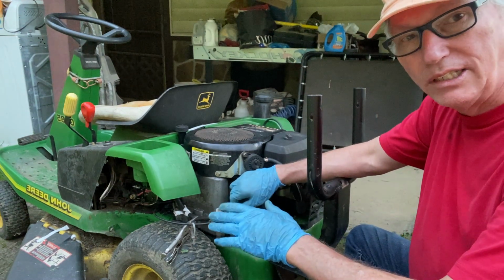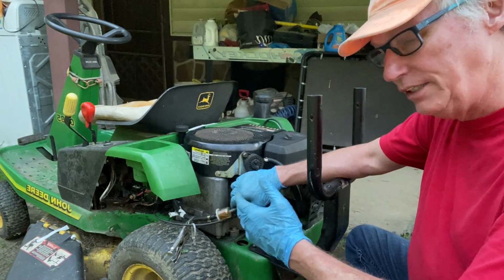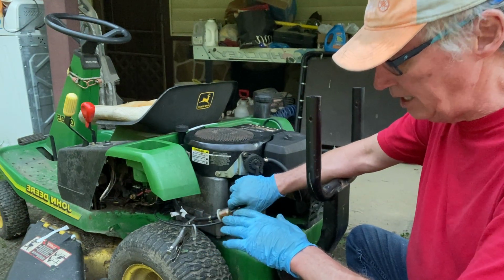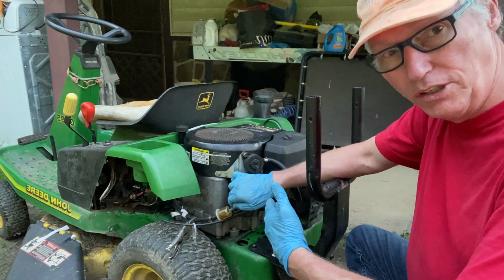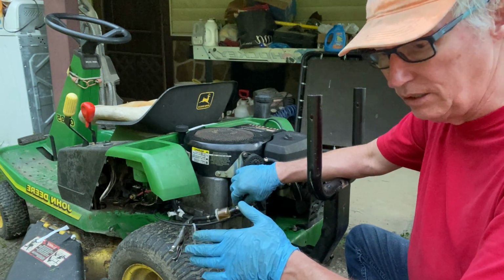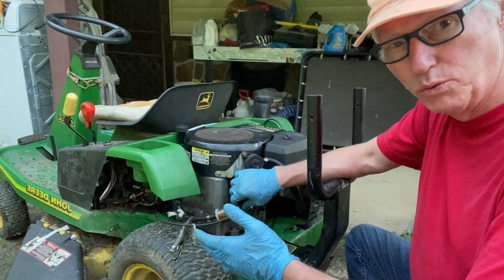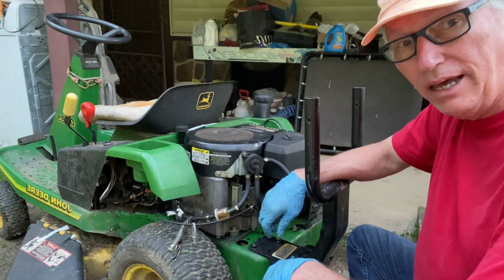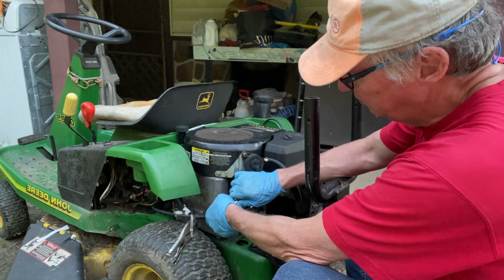it's not only double the size, but it's gonna flood your carburetor out. It did work fine for a while, I want to say. And I can't guarantee that it does flood out that float in your carburetor. But I'm gonna go back to the original because I'm putting this new gas pump on there. I don't know if it might mess with the actual gas pump mechanics of how the engineers designed it. So we're gonna go with this.